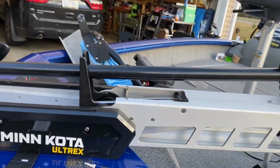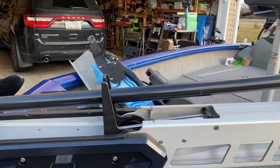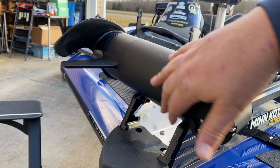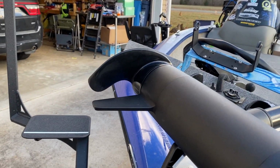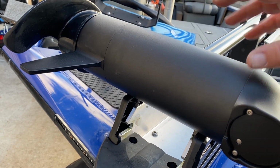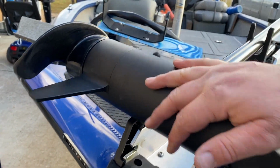The reason why I didn't buy the Mega is I watched a video from Russell Marine, and the guy said if for any reason you were to damage your transducer, let's say you had the Mega down or side, you basically pull your shaft out and send it back to get fixed. What he recommended was save the money, buy the standard US-2 sonar and put your Mega down or Mega side imaging transducer on the outside. That way, if you damage the transducer, you still got your trolling motor to fish. That made sense when he was talking about putting the external transducer on there. So that's what I did.